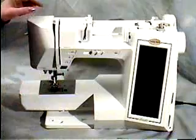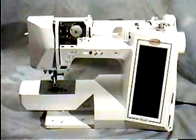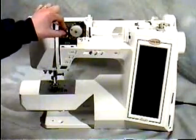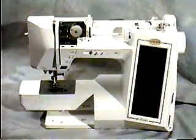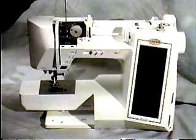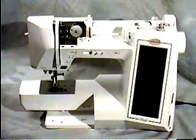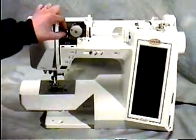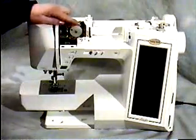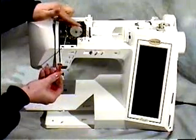After removing the upper tension thread cover, check the black knurled knob to the right of the spring. This adjusting knob should not be free turning and have an approximate gap of 1.5 millimeter from the right side of the knob to the left side of the bracket as a factory setting. If not, adjust the knob and lock the threads with Loctite or fingernail polish, using caution not to get the Loctite or fingernail polish on the sliding shaft.